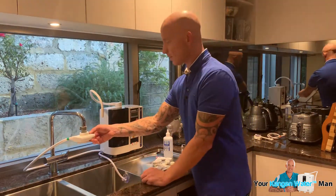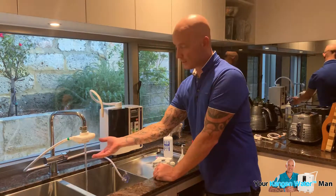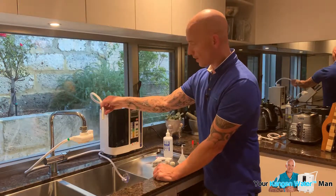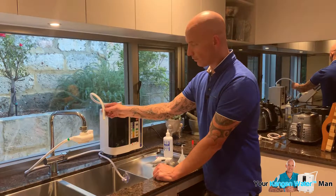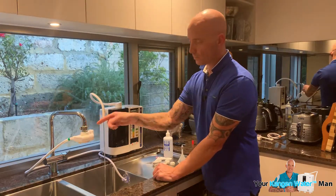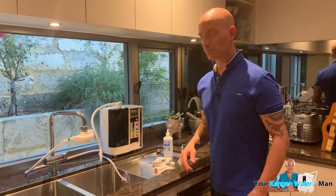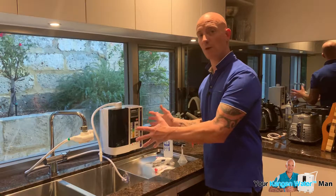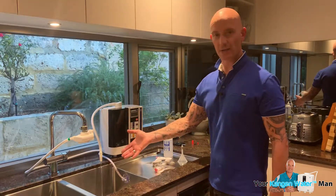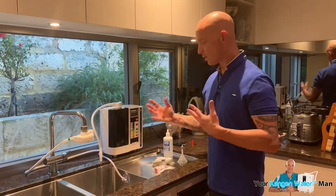Now it's in place, all connected up and ready. I'm going to turn the tap on. Tap water comes out the bottom - turn it to ion and the water is now going into the unit. This is only a rubber connection on there temporarily. Don't worry about that water. The unit works without the power on - it doesn't charge the water though. The water is still flowing through, going through the filter, and actually creating filtered water. Whenever you get your unit, it's really important that you run the water for several minutes to flush out the filter. Very important.